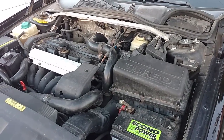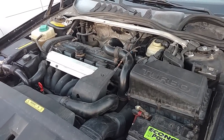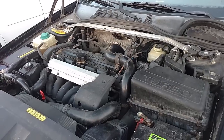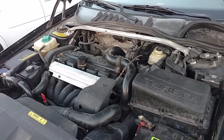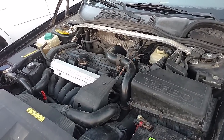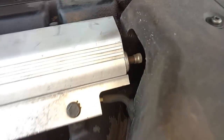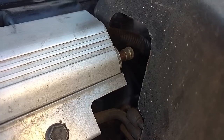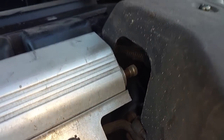If your car is having random stalling issues or it's just simply not starting, there are three ways you can check for fuel to see if your fuel pump is working. Number one is to listen closely when you try to start the car — when you turn the key, your fuel pump should hum for about three seconds. You can listen by leaning the front seat back and listening near the right rear passenger wheel area. Number two, come under the engine compartment and access the fuel rail — unscrew the cap on the end and push something in with a rag. If the fuel pump is working, it'll spray a good blast of fuel out. Be careful you don't get it in your eyes.